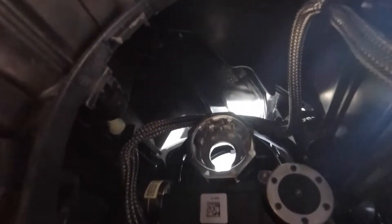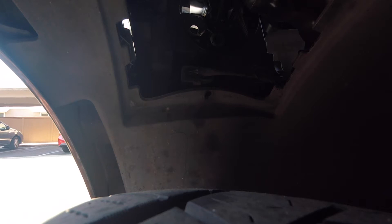Inside there's an opening where you insert the bulb. I already took the bulb out, but you remove it by grabbing it and turning counterclockwise. Note that this Mercedes has active headlights — there's a little motor in there that moves them as you turn left and right — so this specific procedure applies to this particular type of Mercedes.